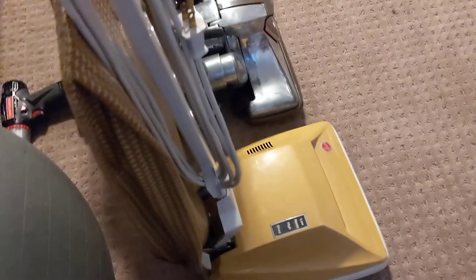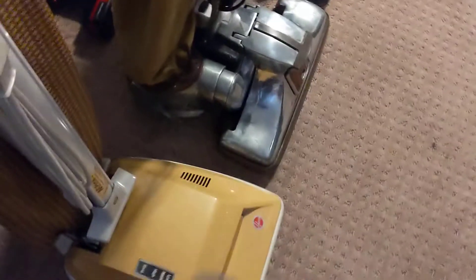The Sunset has to go through two 90-degree bends, or a 45-degree bend and a 90-degree bend, before it gets to the bag. That's a big con - decreasing airflow and increasing brush roll speed. Because of that increased brush roll speed due to less airflow, it rips up carpets more and the brush wears out faster. Plus it has a space for a light and it doesn't have one.